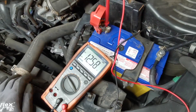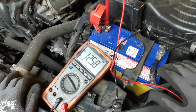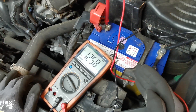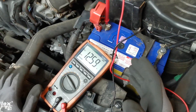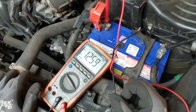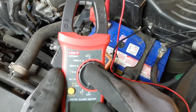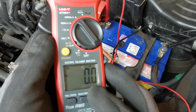I'm back on this vehicle now and I've cleaned up the negative terminal - removed the lead, cleaned all around it - and I'm going to do an extended load test. This test is normally done with a carbon pile load tester: you look at the CCA of the battery, apply half that amount of amps for 15 seconds, and make sure voltage doesn't drop below 9.6 volts. We don't have that equipment, so we're going to use the starter as the load. I have my amp clamp set to DC, rated to 600 amps.